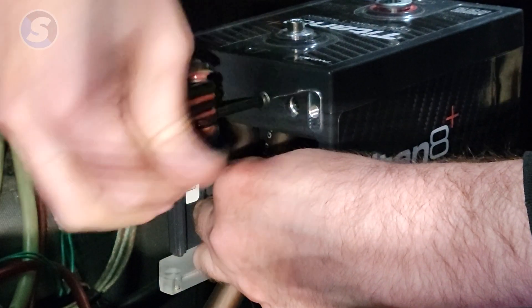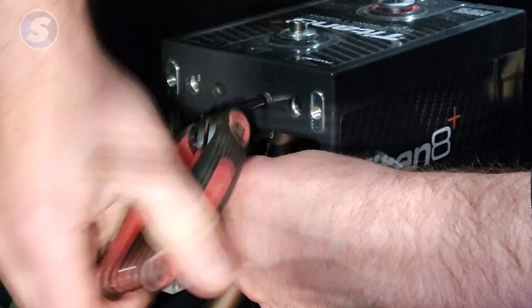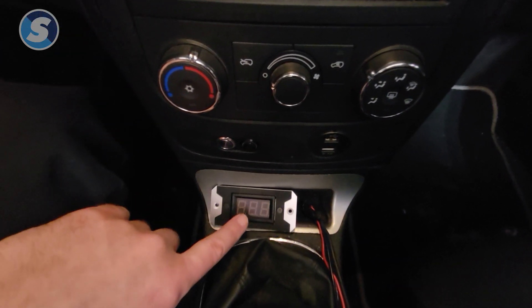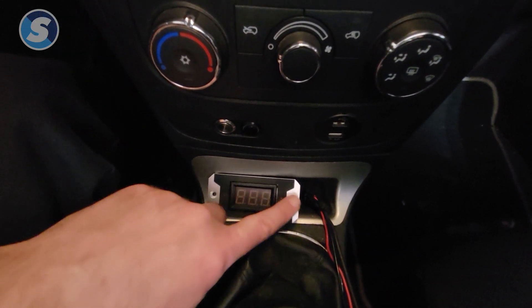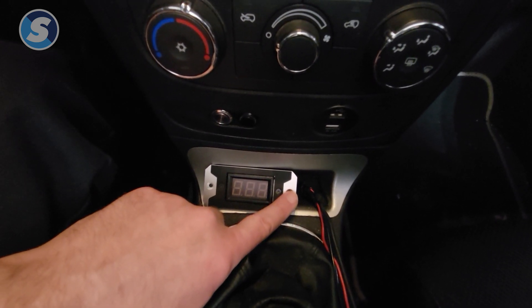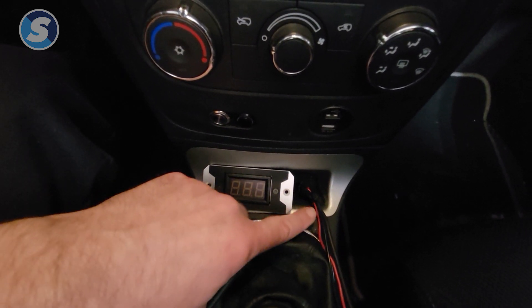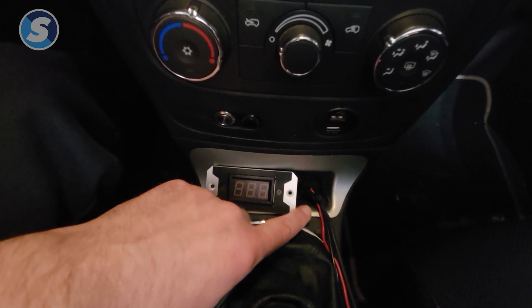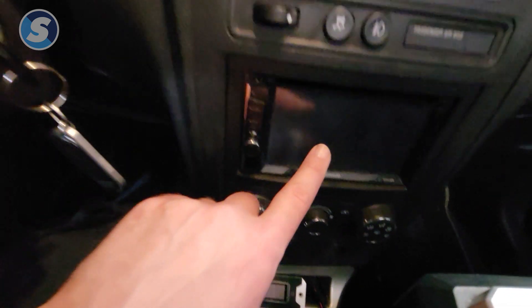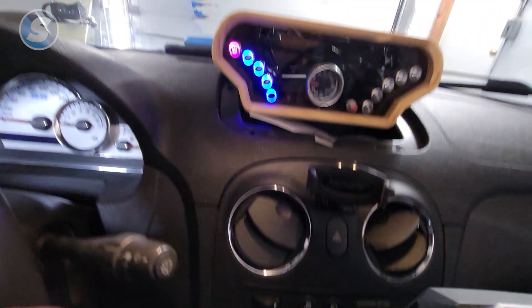The wires from the output of the conductor go to the ground terminals of the batteries. It's important that the batteries ground through the conductor and do not go to chassis ground anywhere else. Until I fabricate a mounting piece, I'm just going to lay it in the pocket, but we give you this aluminum plate so you can mount it to any flat surface. Remember, the ground wire goes to the input lug of the base unit.